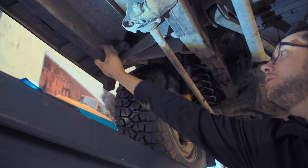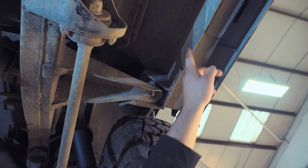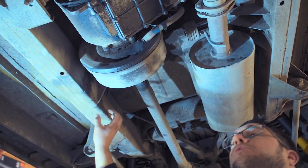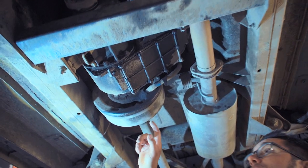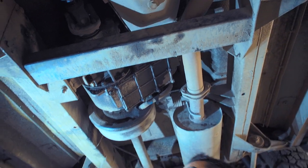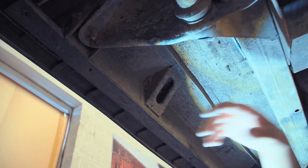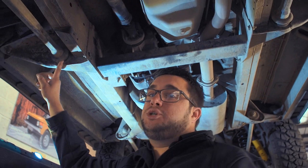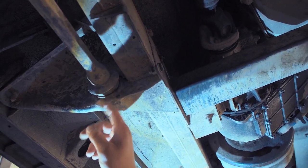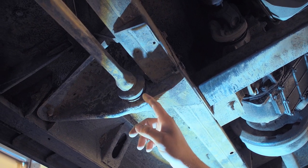As you get to the body mounts, make sure the metal around them is solid — inner and outer sills on both sides. Moving forward, check the chassis rails are solid all the way along. You'll notice slight oil leaks around things like the transfer box — you don't need to worry too much about that, but if it's really pouring out then budget accordingly. Anywhere there's a body mount, make sure there's no rust around them. Check the suspension bushes; if they haven't been changed for a long time it's quite labour intensive to replace, so under test drive do some heavy braking to see if the vehicle pulls from side to side.